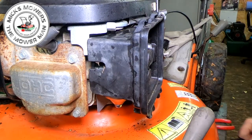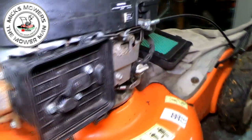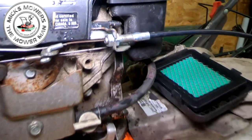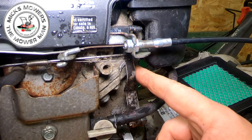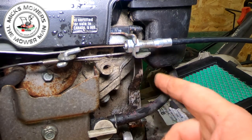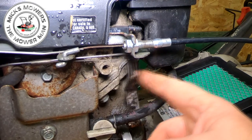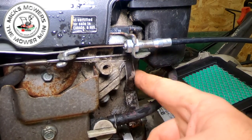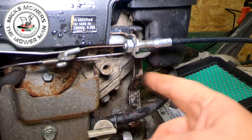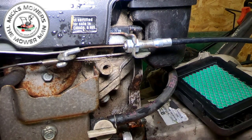Now the question is, of course, does this governor arm now spring back on its own accord, where beforehand it was getting stuck when you had it go forward like so, that's where it stayed at full throttle. But now, look, you can see it's actually running quite smooth. Doesn't get stuck anymore when it needs to go back. So I believe we might have fixed that. Quite happy with that. It wasn't doing that beforehand, so that's good.